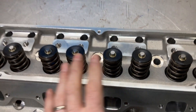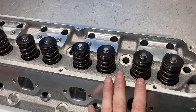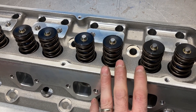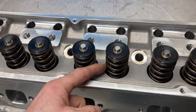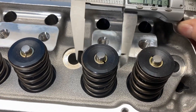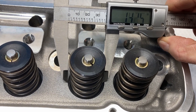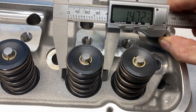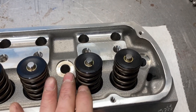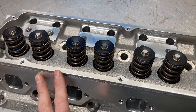It's going to be a lot more aggressive than the first one with a lot more lift. We need to change the valve springs anyway, and we need to see what we can come up with for a valve spring package that will work with our 700-lift cam. The challenge is the spring pocket is only about 1.500 inches, so trying to cram a 1.550 or similar spring in there is going to be futile.